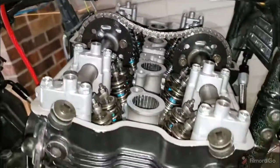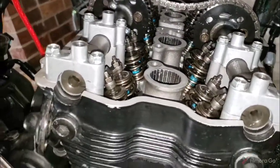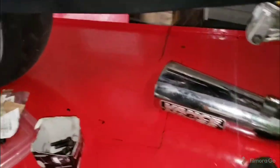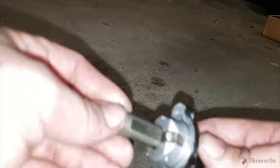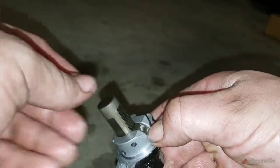All right, guys, and they're all run down, nice and level. If you got into this phase, you've torn it down, you know how this tensioner goes together, but we're going to go through it real quick just to get it covered. Inside of this tensioner, take this 19 millimeter plunger out. There's a spring. What you might not know is how to reset it. See this little latch here? Grab it with your fingernail, pull it down, push it back in.